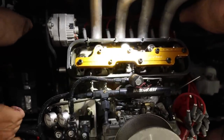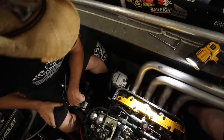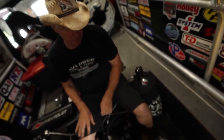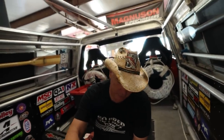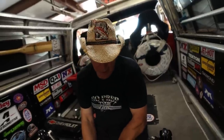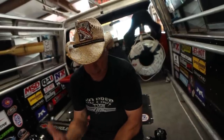That thing looks pretty normal up here. Well, if it would have dropped a valve, there would have been a valve spring explosion in there. And that's really the only thing that, I mean, I've dropped valves before, and what happens is the valve drops straight down into the cylinder, and the piston just keeps coming back up, beating the living daylights out of it, into the cylinder head, and doing all kinds of damage. So what we probably have is a broken rod in the rotating assembly, and that's what stopped it. A rod probably just broke, got in there, twisted, and bam.